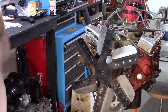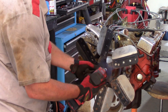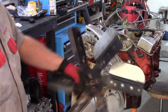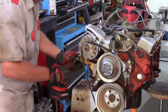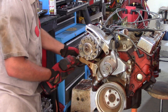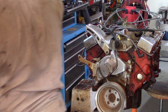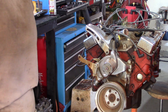I'm going to pull the fan off — there are four long bolts that secure it to the hub for the water pump, so I'll take those out. I label everything — I have little plastic bags that I write on what they are. Next, taking the alternator off: loosen it up, pull the belt, pull that aside. Off comes the pulley from the water pump, then the brackets for the alternator. And it's pretty and it's chrome — my brother was all into chrome so I may just keep all these chrome goodies or add to it.